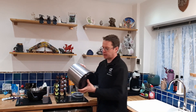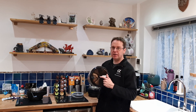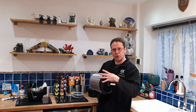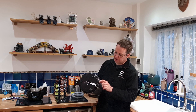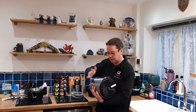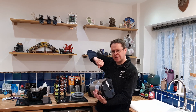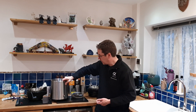This video covers how to open up the base unit. It's relatively easy but can be fiddly. You've got one nut/bolt on the bottom to undo, and there's a little spring washer underneath it. The problem is the base has been pushed on quite tightly. When you unscrew it, look around for any areas that are slightly raised and pop a screwdriver under there. I tend to just knock it in different locations and it will pop off. If it doesn't, get a flat blade screwdriver under the lip and gently prize it — don't twist it or you'll dent the edges.